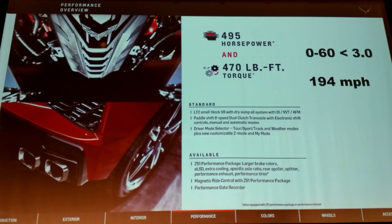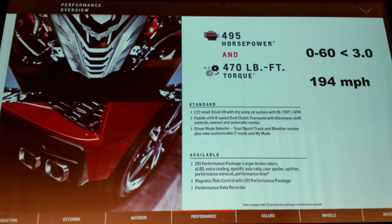There's a pinch point between the block, the body structure, and where the passengers need to be. You actually have to compress the exhaust — you dent the pipes — and it's a very restrictive area in the car. When you put the engine in the back, we've got these really cool short headers that come out over the top and go down under the luggage compartment. There's no pinch point.